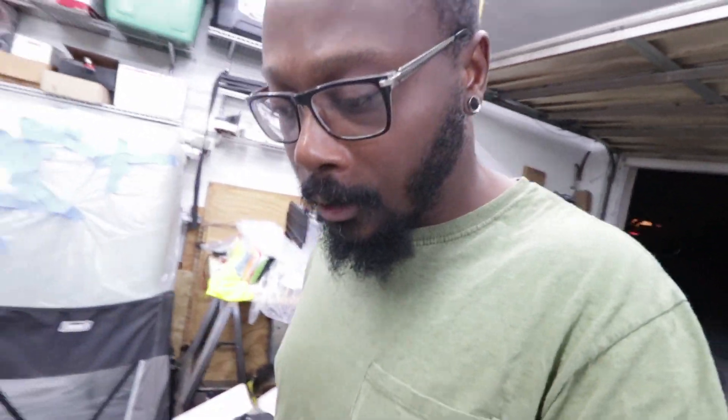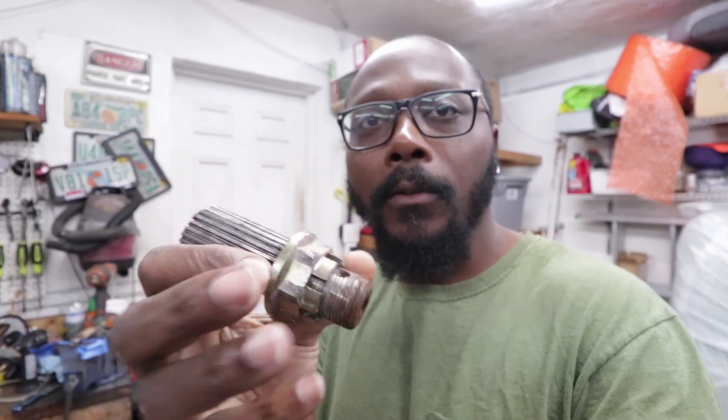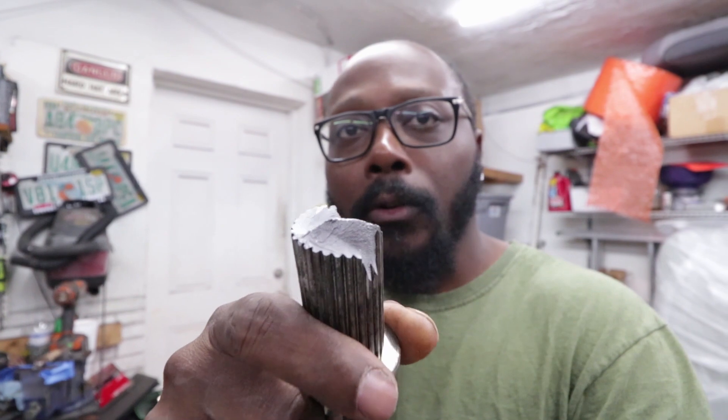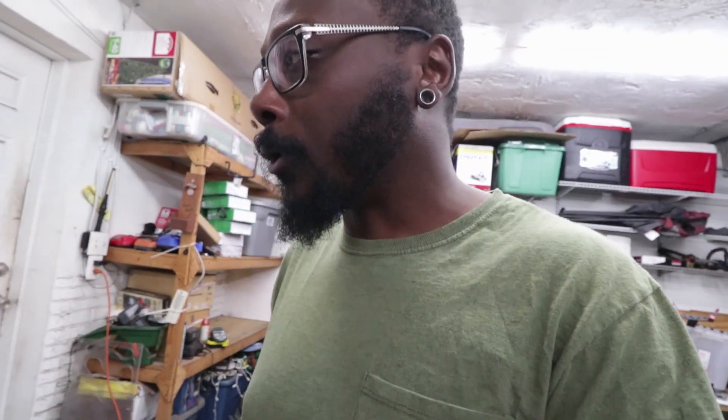She hooked and snapped an axle — just popped. Initially I thought it cracked the cage; usually the cage in the axle is what goes. But no, it snapped the shaft that goes into the axle, goes into the hub. Just sheared it straight off.